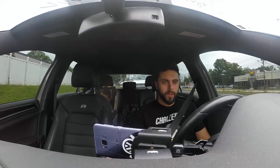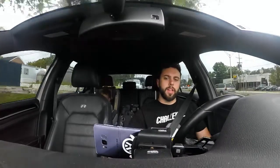Now, some of these don't apply to this car, but just to get a taste of what the JB4 displays, on your display screen, which displays all your gauges, you can get things like RPM, boost, and ignition 1, which is your overall timing, so you'll pretty much always want to be looking at that. Then 2, 3, 4, all the way up to 5 is when you do pop a correction. If you experience timing pull and you want to see which cylinder is correcting itself, 2 is your first cylinder, 3 is the second, 4 is the third, and 5 is the fourth cylinder.